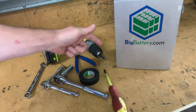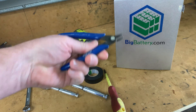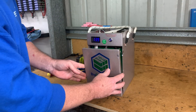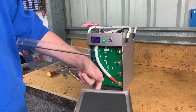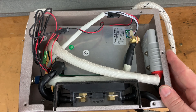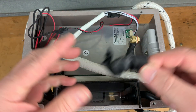Some of the tools you'll need to get it apart: a Phillips head screwdriver or drill, insulation tape, a 14mm and 10mm socket or spanner, and side cutters for the zip ties. Three Phillips screws on each side, take the front cover off, and five on the top. With all screws removed the front cover comes off, revealing a perspex shield, a thick layer of foam underneath, and the battery terminals protected by rubber cones. I've already removed the zip ties and the heat shrink off the terminals for easier access.